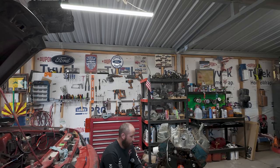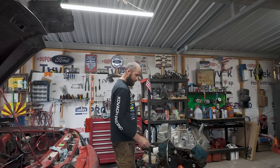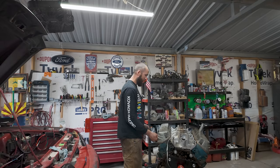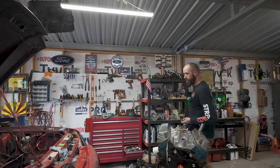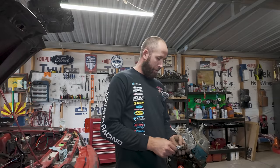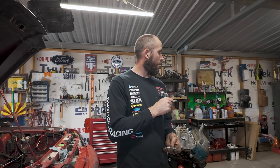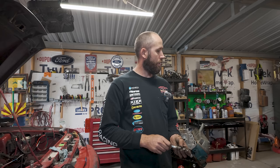Well, it would appear that these do not. Good to know. Need to pick up spark plugs for a 98 Explorer with a 5 liter. So I'm finding out things so you guys don't have to with this swap, because I didn't look it up beforehand. Factory 5.0 spark plugs for the E7 heads will not work. You're gonna have to use different ones.